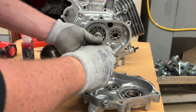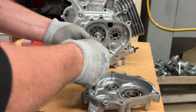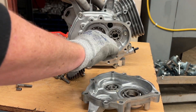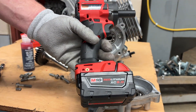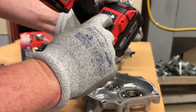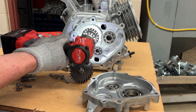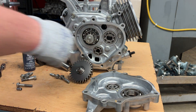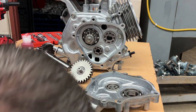I'm threading this by hand, being careful — back it out until you feel it click. I felt those teeth of that thread engage: I went backwards, then forward. We have to torque this on, but when I'm turning it, it's turning the crankshaft — I can't torque it on because it's turning the crankshaft. So this is one of the few times we will use the impact gun. Set the arrow pointing forward going forward, put it on one speed — one short burst, one, two, three. Now we've tightened that up.